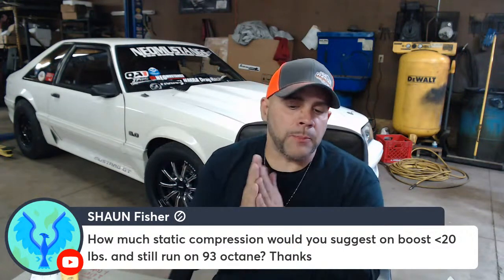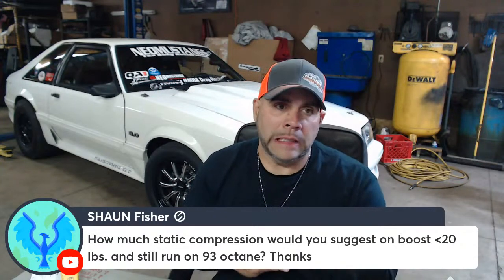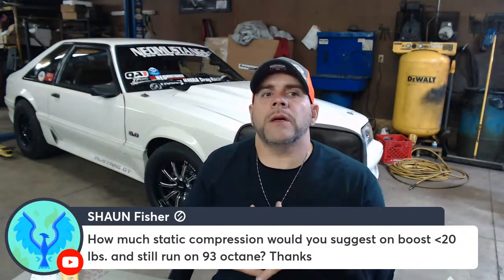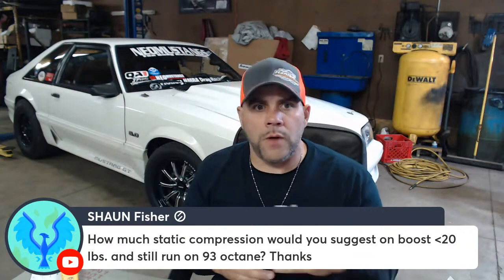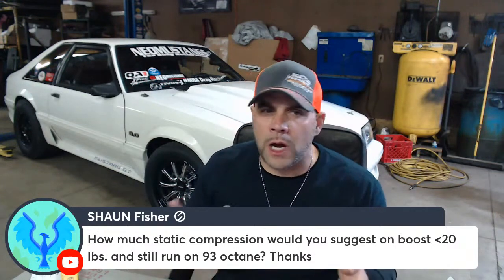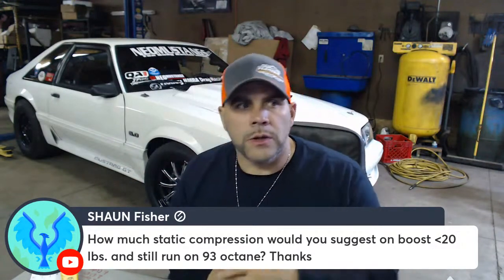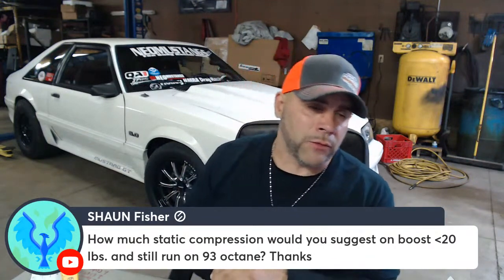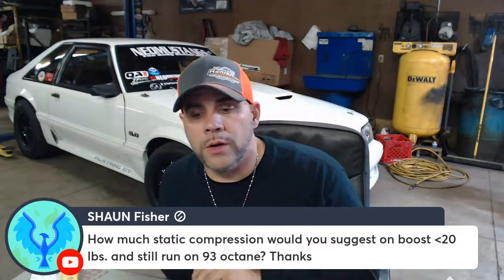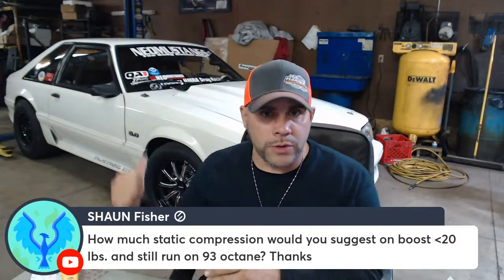Sean Fisher, how much static compression would you suggest on boost less than 20 pounds? It's still 93 octane. To be honest with you, with the compression question, I think a well-rounded motor is one that makes about 10.2 to 10.5 to 1. 93 octane, I get the whole idea behind 93 octane being cheap, but to be honest with you, the money that you would save running E85, and E85 really doesn't care about compression. We run 11.2 to 1 on my black 363, my black car, and we're probably every bit of 10.5, 10 3/4 to 1 here on the white car.